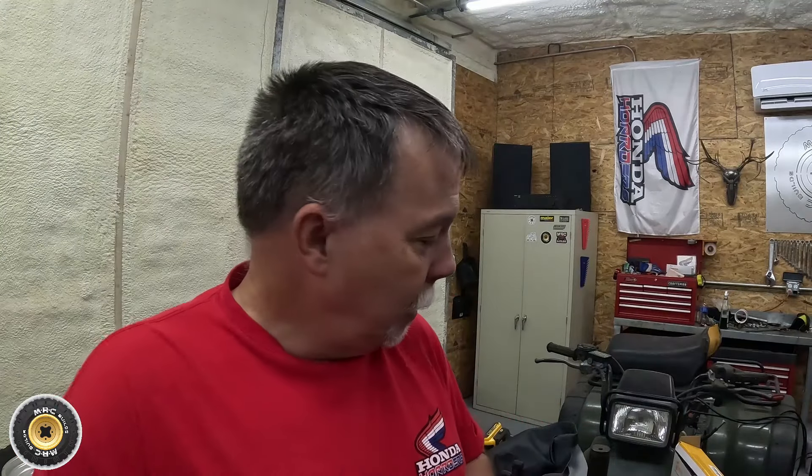We're going to put in this relay kit - opening it up together, I've never done one of these. The reviews are really good and there are a couple of videos on YouTube. It's pretty straightforward - two relays. Part of the problem Honda was having with these is low voltage. Before I turned the camera on, the battery was dead and it wouldn't shift - it would get hung up in first or second and couldn't get back to neutral. I put the battery charger on, hit the shifter and it shifted. Low voltage plays a role in why some of these don't shift, and apparently these relays override all of that.